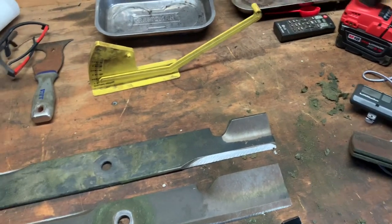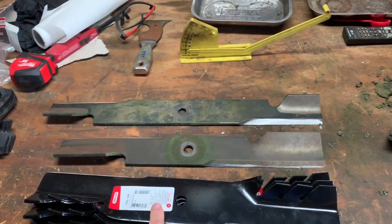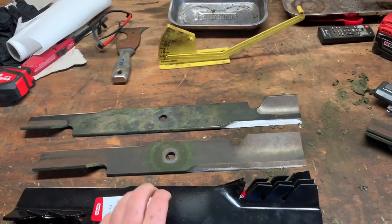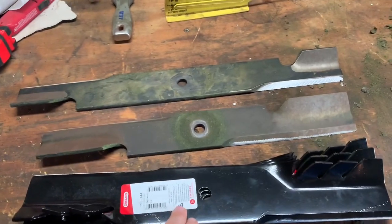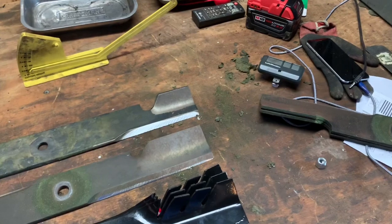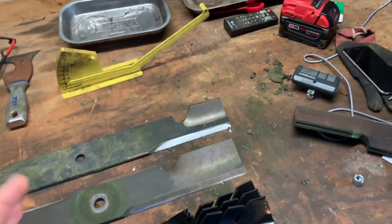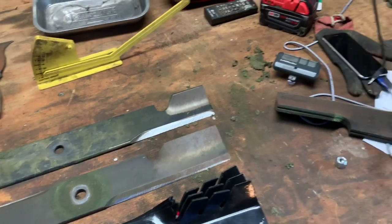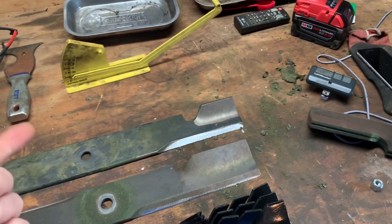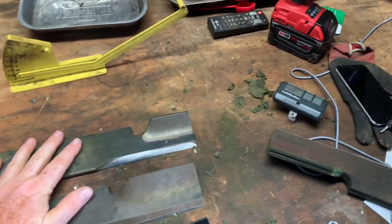That is the major issue with the ICD deck — and this is how I handle it. From mid-October to the end of the year through April 15th, I run the Oregon G5 Gator Blades. So to recap: check the tire pressure, check the deck level, make sure the deck is within specs, and then work out your blade configuration.